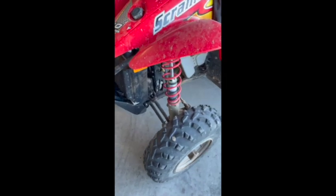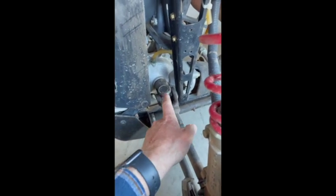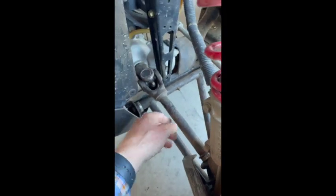My question was: can I ride this 400 without this axle in place? In other words, could I remove the pin, remove it from the CV, and run it with just the stem and the boot? The answer to that question is absolutely yes, and it does just fine. The only downside is you will not have all-wheel drive or four-wheel drive.